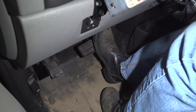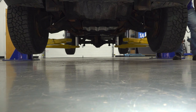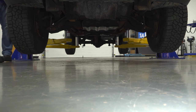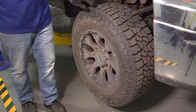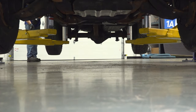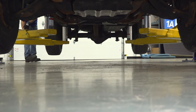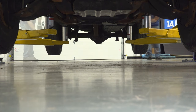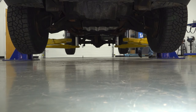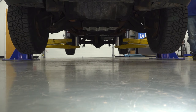We're going to raise the vehicle up so all the wheels are off the ground, and then we're going to pump the brake pedal. After that, we're going to go around and check all the wheels to see if they actually spin freely. That one barely moves. See, that one stays spinning — that's the way it should be. The rears are moving, but the rears are a little sticky. The major problem is this front one.